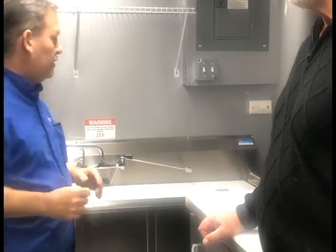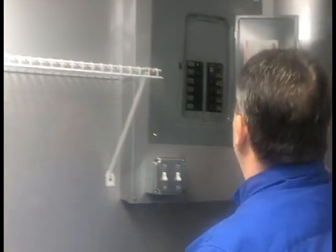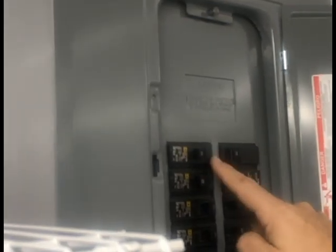Thanks Steve. The water system is unique because there are several steps. If you do not do those steps every time, you can have issues with the water pump, and that's one thing you really want to avoid. First and foremost, come into the trailer and go to the breaker panel box, which is clearly marked water heater and water pump. Switch off the breaker to the receptacle that the water heater and water pump are plugged into.